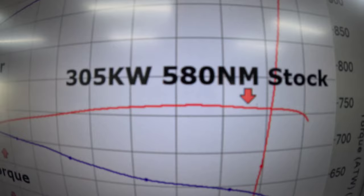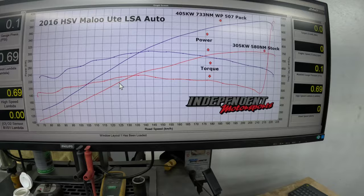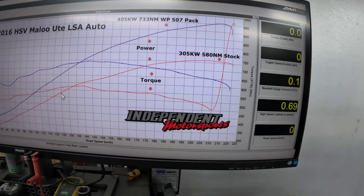This is the best part of the pack, and I'm so happy with the results. In stock form, as you can see, it made 305 kilowatts and 580 Newton metres — at the hubs. For those saying that seems a bit high, just take 13 or 14 kilowatts off for a roller dyno. I probably shouldn't need to keep saying this, but there's no such thing as a 'real dyno' — a real dyno is the one you use consistently and it's repeatable.